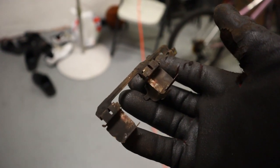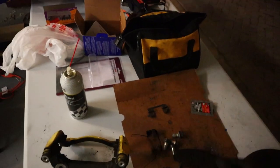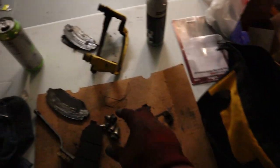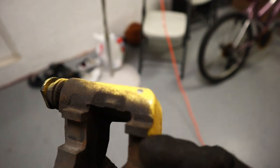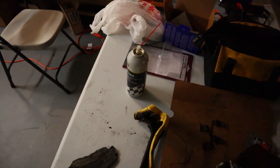These two clips are what hold your actual brake pads in. You just want to clean up these surfaces and clean up the back of it — make it look as brand new as you can. If you have some brake cleaner, spray it on. Mine is actually in pretty good condition so there's no need to replace these things, they just need to be cleaned up with a wire brush. I'll probably hit it with some brake cleaner because the passenger side for some reason has way more brake dust than the driver's side, which makes no sense to me. For this, you just want to clean the mating surfaces where the clips sit — on top and on bottom, same goes for the other side.